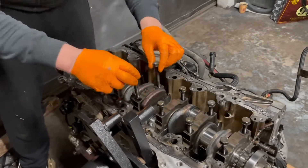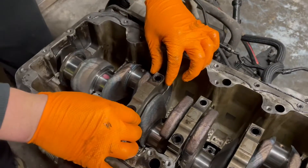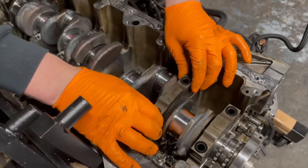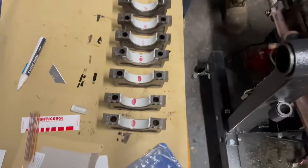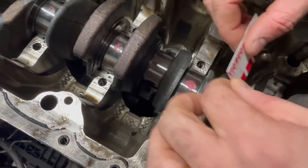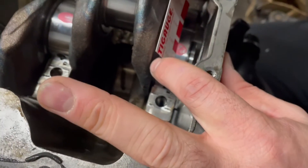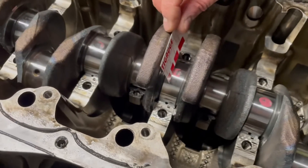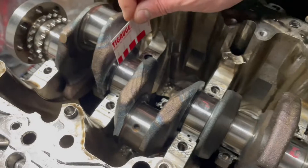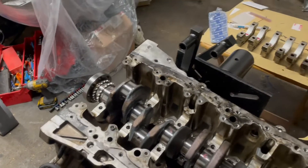Let's see the results. These bolts are done — they won't be reused. On some caps the plastigage unfortunately stayed on the cap side, but that's not a big problem. We measured all seven caps and had a reasonable reading — all seven were under 0.050: readings of 0.047, 0.043, kind of in the middle. Not at the tight end of 0.025 — for me that would be too tight — but not at 0.065 either. I was more than happy with the results. I'm very confident in the Kolbenschmidt brand.